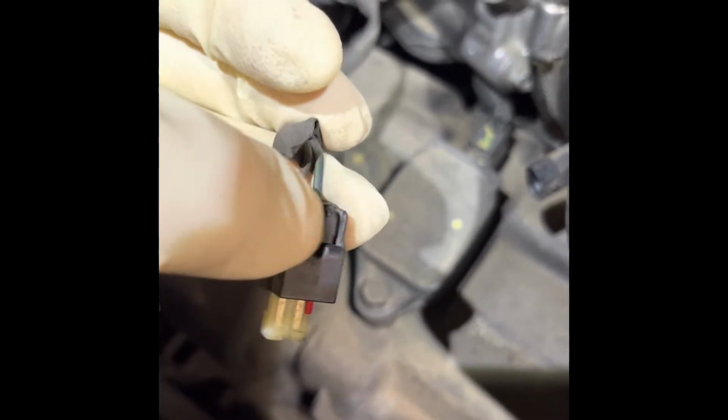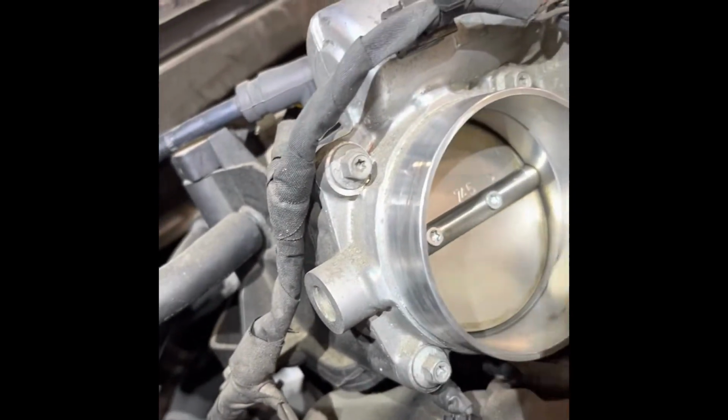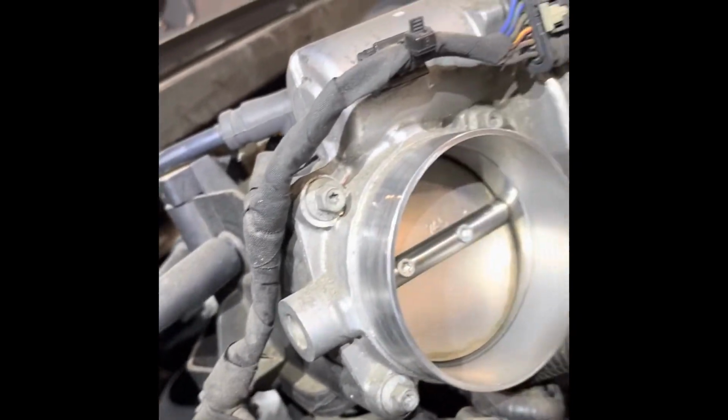And also disconnect every electronic first. Alright, so after you unlatch the box there, you're gonna come here to undo the sensor. Use your nail, press in and pull. And this little tab right here, press and pull. Okay, then this just comes up, loosen up the 8mm here, and then give it another little wiggle, and it's out. If your throttle body is dirty, spray a little bit of brake clean or throttle body cleaner, clean it with a rag to increase airflow.